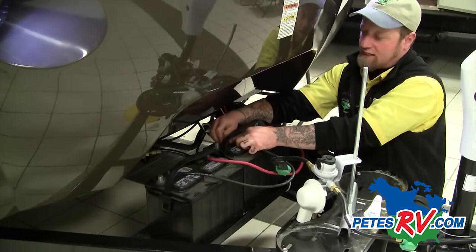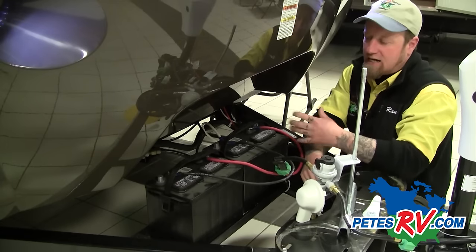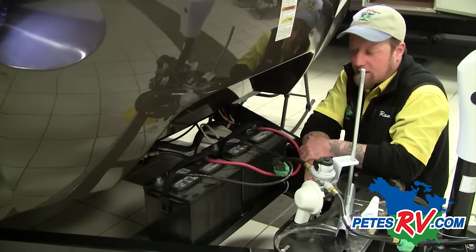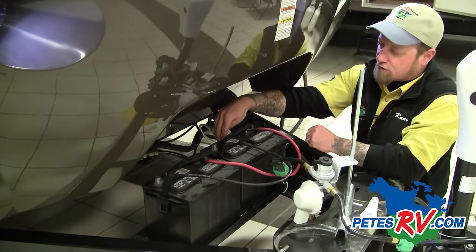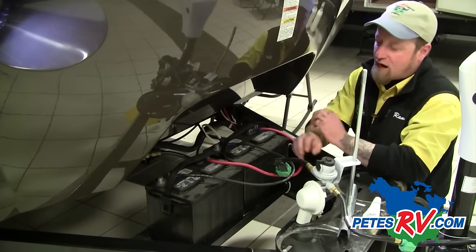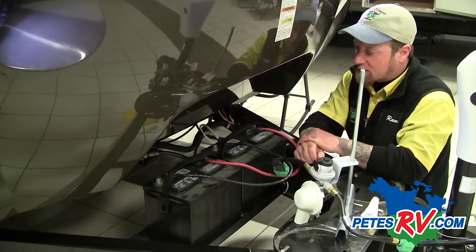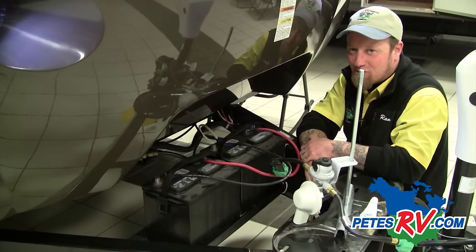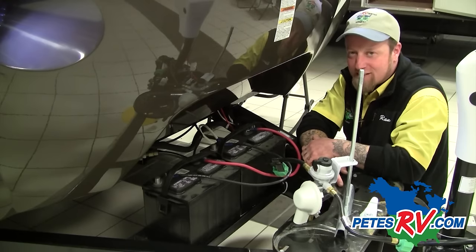This is going to give us a 12-volt supply to the coach and a lot more longevity when using this camper in a dry camping situation. These batteries will be charged while driving down the road if you've got an appropriate charge line in the truck. So to recap: positive to positive, negative to negative, put your positive from the trailer on one battery and your negative from the trailer on the other battery so they de-cell at the same rate. Make sure your batteries are purchased at the same time. We've always got discounted pricing on batteries at Pete's RV Center. Thanks for watching — check us out on Facebook and YouTube, and happy camping!